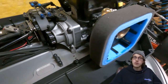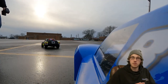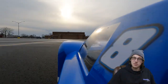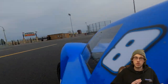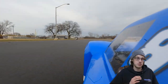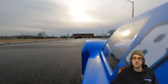After doing the whole conversion, as you can see on screen, it wasn't hard to get started. I used the stock settings that Losi gave in their manual and it actually started right up. Once it got started it was a little hard to tune — you really have to listen for it. It was running really lean. I fattened up the low end to right around four turns out from the bottom, and the high end to about four and a half turns — definitely over twice the amount of fuel needed to run methanol in the stock carburetor.